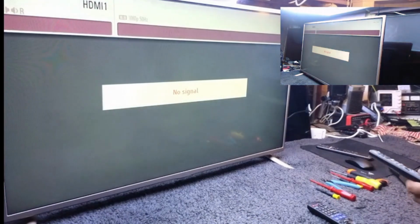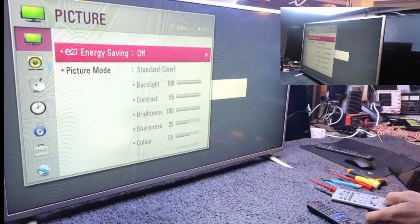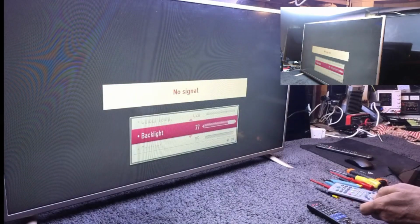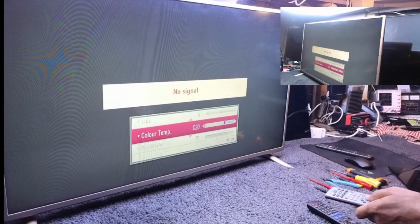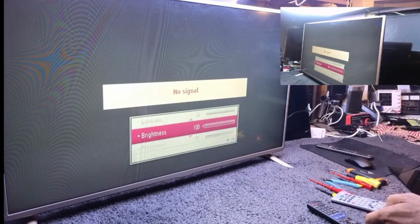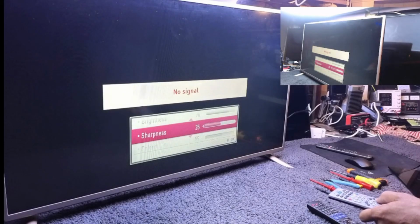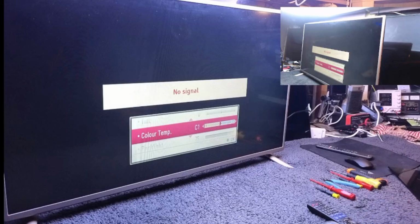And we're ready. Oh, that's a very bright picture. Let's just check the menu. Wow. Okay. I know it's had brand new backlights, but I'm going to turn those down to 3/4. Color temperature is too far up, as they always are on these from default. Contrast is okay for now, but brightness, wow, that's the problem on that. Let's turn sharpness up a little bit, I like to. The customer can do that, obviously. Tint is fine. Color temp, as we say, is done. So that should be a bit better.